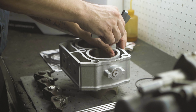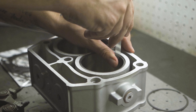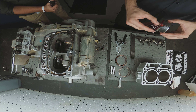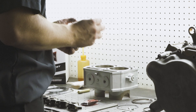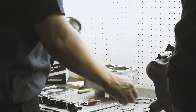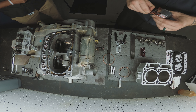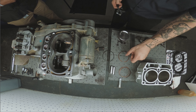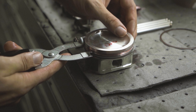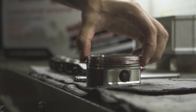You can refer to your manual for the proper ring gap specs. We're going to apply our Maxima assembly lube on the ring grooves before we install the rings. Make sure to always install your ring gaps staggered. As the rings are installed into the grooves, make sure to work them around, get that lubricant moving, and really work them into the groove.